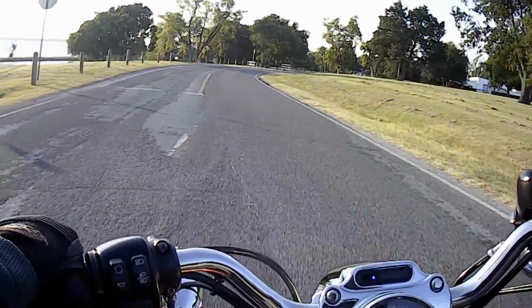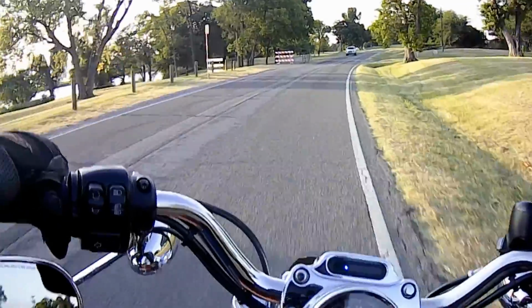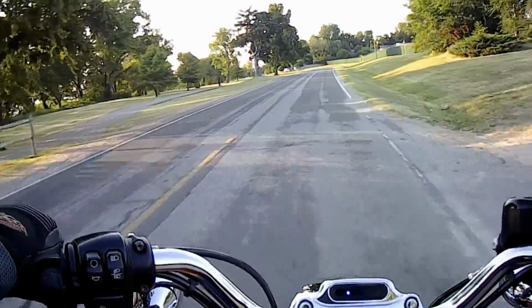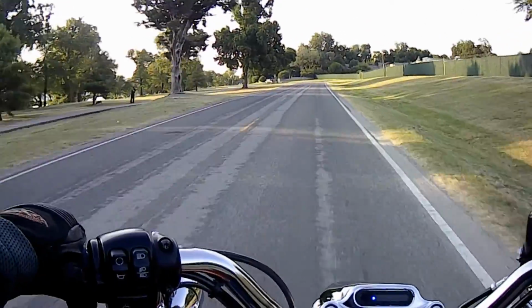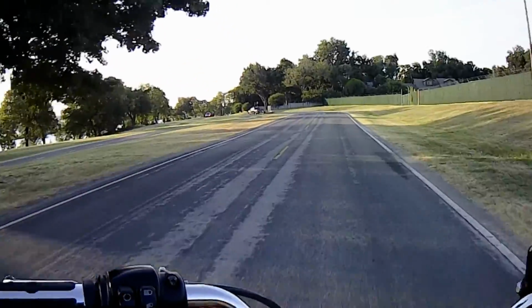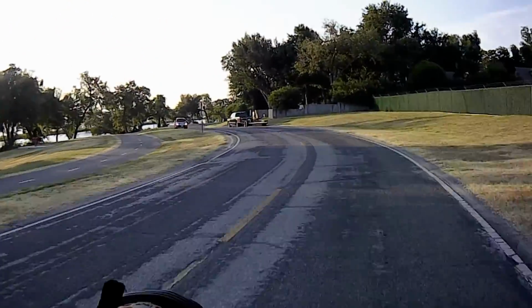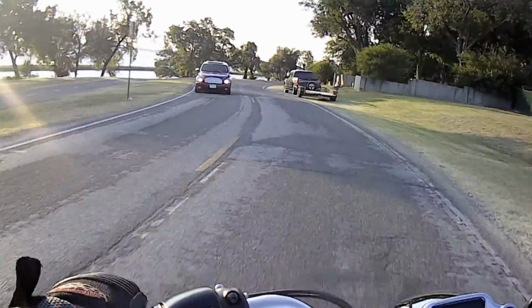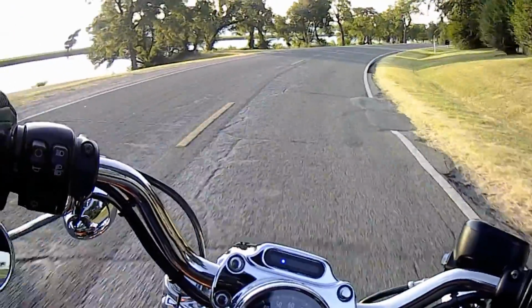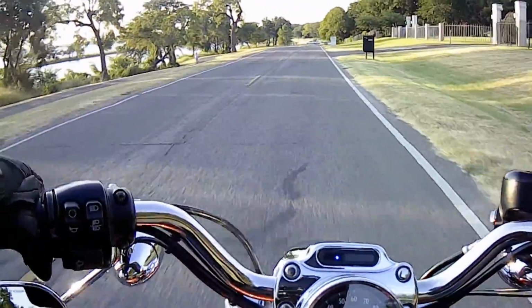Okay, today guys, I want to talk to you about a kit that has been on my mind for quite a while now. It is the Stage 4 kit from Harley Davidson for your Sportster. Now, this kit comes with CNC ported cylinder heads, a 58mm throttle body, and a manifold to mount the throttle body. It also has 585 lift cams and 10.5 to 1 compression pistons.